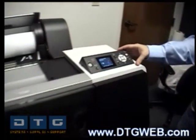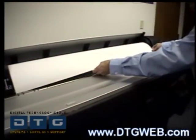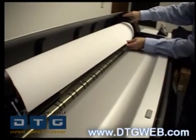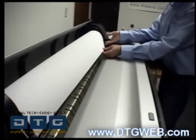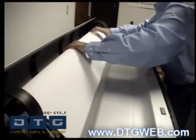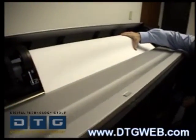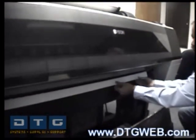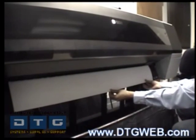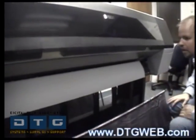To feed the paper into the printer, bring the paper down into the paper path. When you loaded it onto the media end caps, the paper should be winding over the top and down into the printer — not the reverse. Simply grab the paper and feed it down into the machine until you can see it coming out the front. Pull it down a little bit; it doesn't have to be perfectly straight because the printer will load and straighten the paper itself.